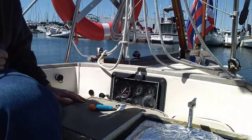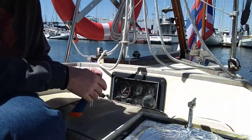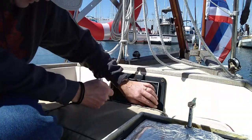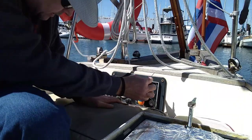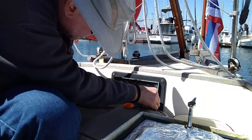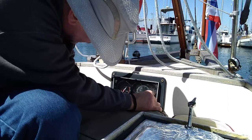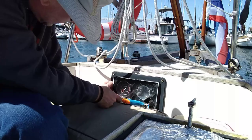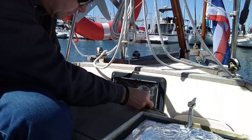So I've disconnected the battery, and I want to make sure that there's no power going to the engine. I'm going to try this — ideally we get no tone, we get nothing on the needles, we get nothing. All right, we got nothing. We have a disconnected battery. Good.